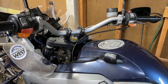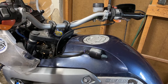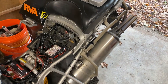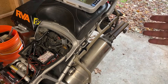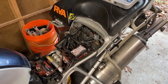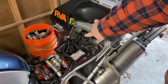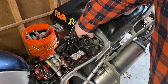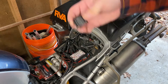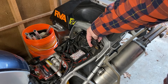I've prepared my work area. I've got the key in the ignition — I'm going to need to turn that on to provide power to the GS911 and to wake up the computer. I've removed my right side saddle bag so that I can get in close. And I have located my diagnostic port, which is right here. It just unclips, and then you unscrew the lid counterclockwise, set the cap in a safe place, and then you can see all the pins.